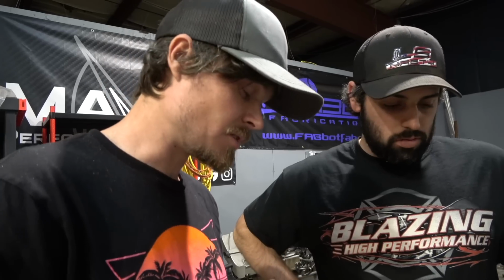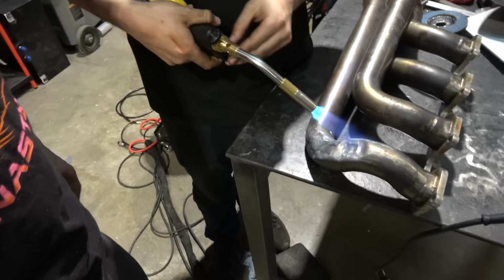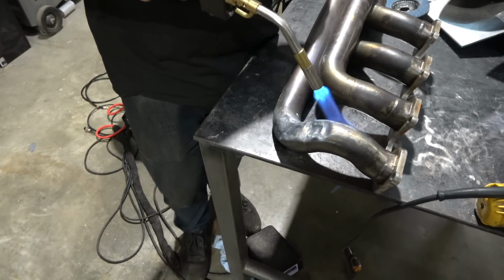Well, yeah, because during a run, the drive pressure, it's going to be cherry red, the whole entire thing, and you're going to have 50 pounds of pressure in there. So if there is a crack, then it will show. It could have just been where it was being hammered and some material laid over, but it looked like a crack before. Let's get it hot one more time and just look at the whole thing. We're going to start from the top.